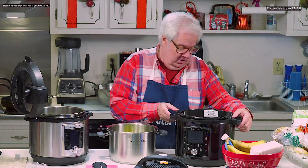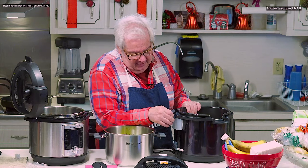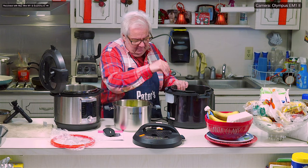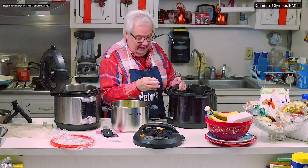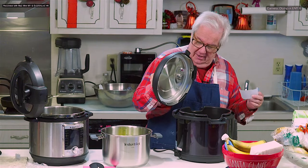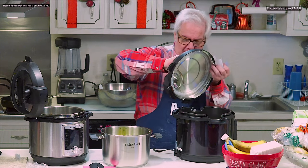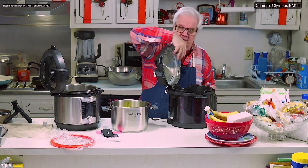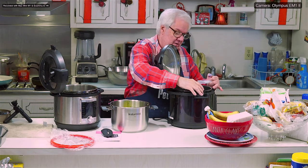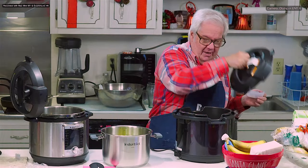I'll get to that in a second. All right, so on the back of this here, there's this little plastic cup. It's got tape. Okay, so the purpose of this cup is it slides out like a drawer, straight in and out. This accepts the water that's going to drip when you open this up, okay, and you seat it like in here. Can't find the hole. Okay, I found it. Okay, the water will drip out of this just from sweat, and it'll go in this big ring, and it'll come out the back over here into this cup. All right, so that's what that cup is for.